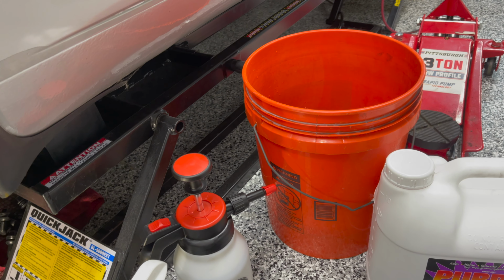So the next thing is your bellows, your bump stop. Be sure to push your bump stop down past the lip so that you can get your washer in on top of that. And it should sit together like that. All right? Then the next thing you do is you put the concave washer concave down, so it's dome up, and then your cap. And your cap has a ring where the spring actually sits.